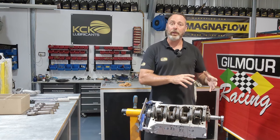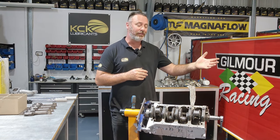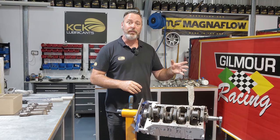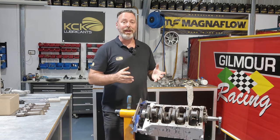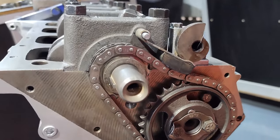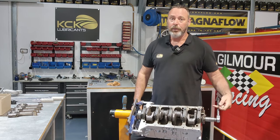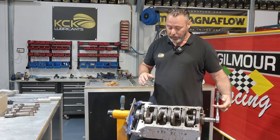The camshaft thrust plate has been installed as well as the timing gears. The gears only go one way - timing marks to the front of the engine so you can see them. The crank gear has a really large chamfer on the inside that goes against the shoulder on the crankshaft. Thread lock everything on the front of these - it'll fall apart otherwise because of the high RPM, harmonics, vibration, heat and stress. The proper cam locking plates actually lock the bolts in as well. Now that it's together it turns over super smooth - no funny grinding sounds, no swarf falling out the bottom.